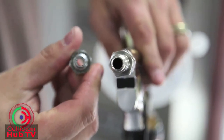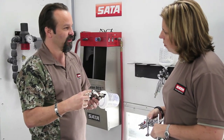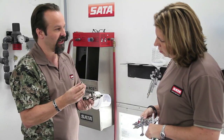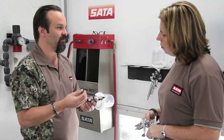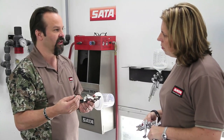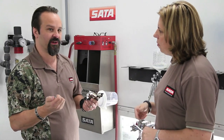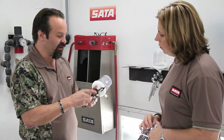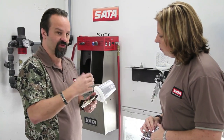When we use high-flow fittings, it opens up so air can travel through with high volume but low velocity. If I use smaller fittings — like the Lincoln fittings with the real long thin neck that will literally slip inside of a high-flow — airspeed has to increase to get through. You can do everything right in your paintwork and still have a poor paint job — your clear not laying down well, your base coat not laying down well — simply because of the fittings you chose.